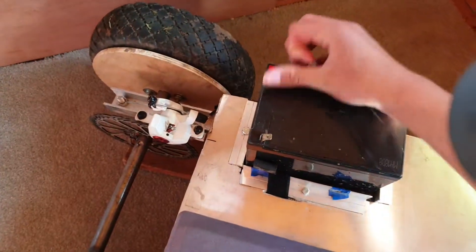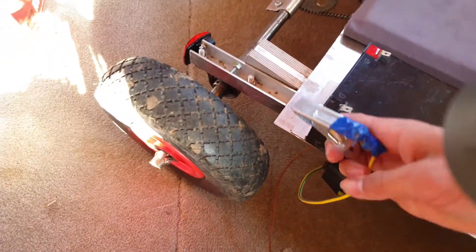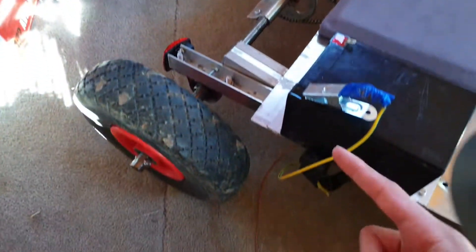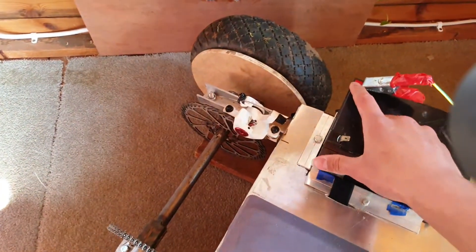To plug it all in I've got these four clips. To connect the battery, normally would put that under the straps of course, but there's a little protector on that — just flip that off. So how I wire it in: I've got this one marked with the earth cable, it goes on the outside, and then on the other side the earth cable again on the outside of the battery. So this earth cable goes straight down here under the go-kart and reappears on this side. This wire is all one wire, not connected to anything else — that just connects the plus to the minus so that we have it in series.